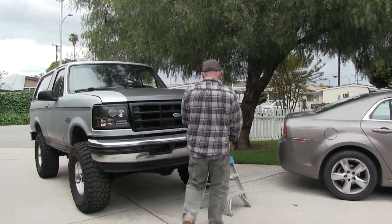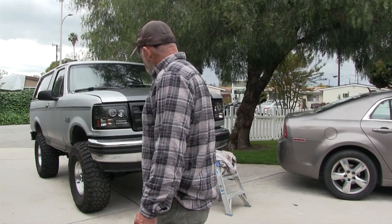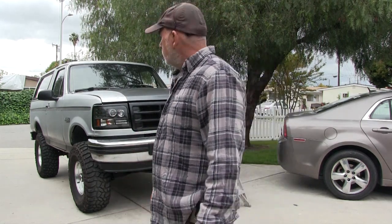I'm done. Gotta clean up the oil mess now - I've got that big bag of kitty litter. Like I said, I couldn't find nothing wrong with that rear end. I've checked the bushings, checked what's clunking. I did some searches on the internet and some people have that problem and it turns out to be their brake pads - disc brakes, the pads shift forward going forward, so when you back up and put the brakes on they may kick back and make a noise. But this doesn't have disc brakes in the rear, it has drum brakes. It's really hard to tell where that sound's coming from - it feels like it's right under the seat. That's why I changed the radius arm bushings and brackets, but there's just nothing. The axle pivot bushings, tie rods are tight, everything's good.